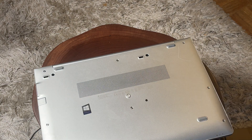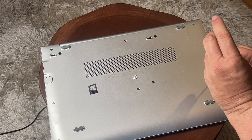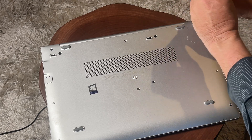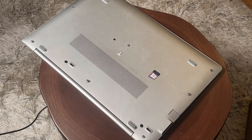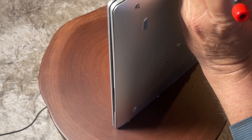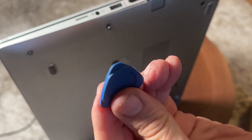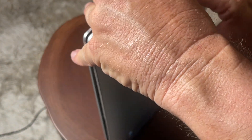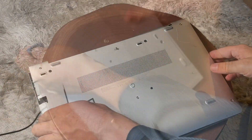Let's go ahead and do that now. We'll unplug the power from it. This one does have a built-in battery — if it didn't, I would disconnect the battery. We're going to remove all the screws on the back and even on the top — there are two recessed screws. Make sure when you open your laptop that you remove all the screws. There are clips all the way around holding the laptop together, and I use a guitar pick, wedging it in and going all the way around to loosen everything up.